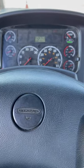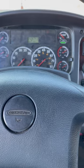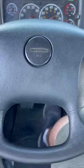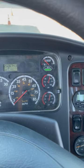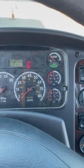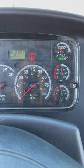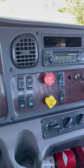The next test is the low warning light. The low warning light comes on at no less than 55 PSI. I'm going to release pressure. It came on at 70 PSI — that is a good test.